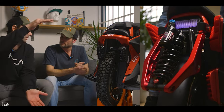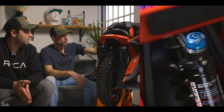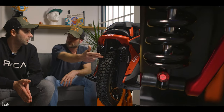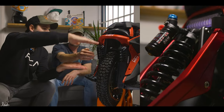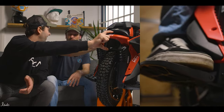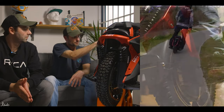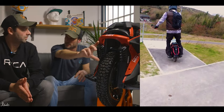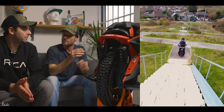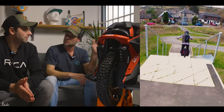That's right — 130mm. You've got the actual size of the shock absorber and the distance it travels within that stroke. But what that translates to through the suspension, through the rocker arms, is the actual distance travelled from the wheel — this whole section is moving down towards the wheel and back up. You need a huge clearance, and through the design they've managed to use different points of leverage and adjustments to make it a long stroke. A long-stroke shock absorber has quality throughout that entire stroke and performs all the way through, which is critical for both air and coil shocks.